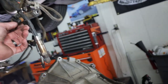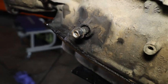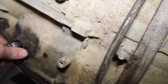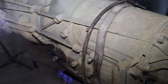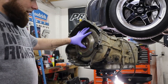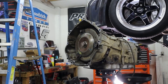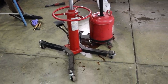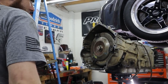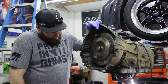The actual gear select lever is notched in a square, so you can't really mess that up. You take this nut off, line it back up on there, and it should be good to go. But yeah, this transmission is dirty. So I got the tranny out, got it all washed off and cleaned. I owe my buddy a drain pan because it was under the tranny jack and I lowered it down onto it — yeah, it was under there. So I'm gonna go buy him one of those.